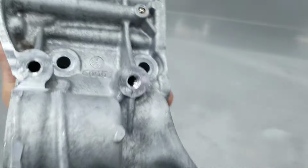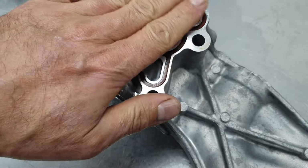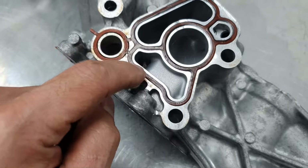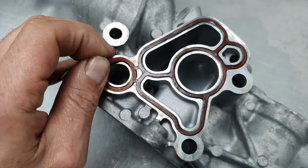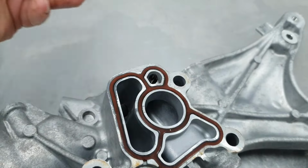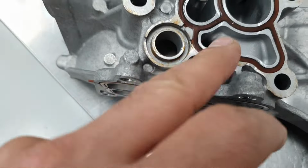Lovely. Now, see what's my point. This is the side that's going to the engine block. Yeah, it's tired. The seal is gone. But I don't think it was leaking. It was mixing coolant with oil from this seal. So I have to take it out, and that's why I'm saying I have to wash it again, because from underneath this seal, you can have some oil. Keep it here because I have the solenoid, the pressure sensors, and the other stuff there that's being washed. And yes, I need to wash it again.